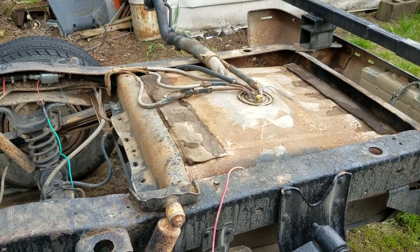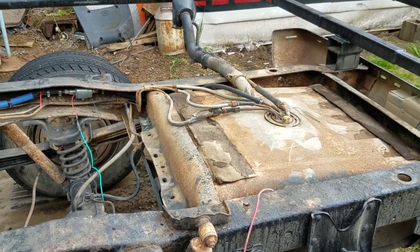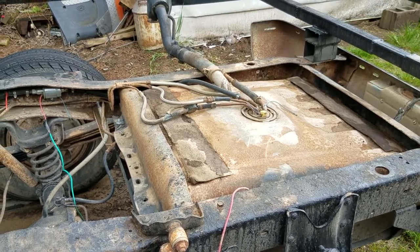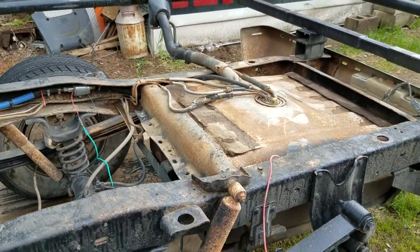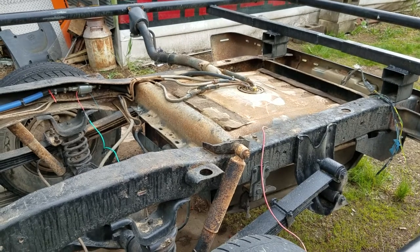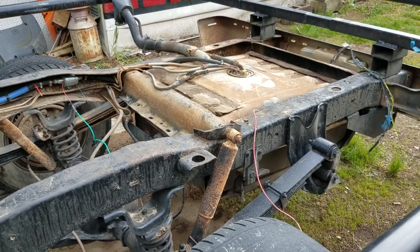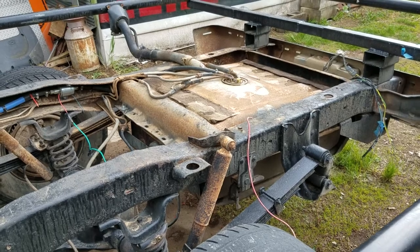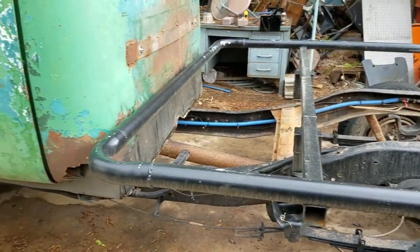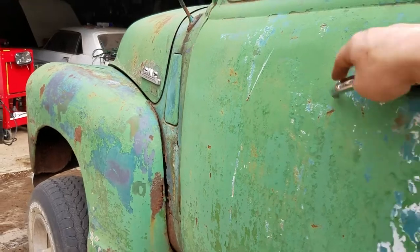I put the original gas tank back on it. I had just a little 10-gallon fuel cell on here but it would've been a pain to make a fitting to fill the gas. I cleaned out the original tank because it was so bad — rocks and just all the stuff from the fuel pump that the ethanol ate was just laying in there. The ethanol had eaten away all the rubber and everything inside the sending unit, so I took all that out. This truck is actually converted to carburetor — I've done that conversion a few times on these TBI trucks.